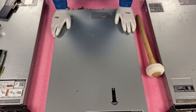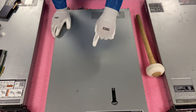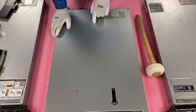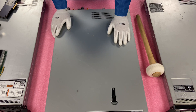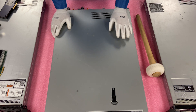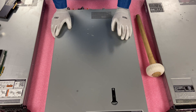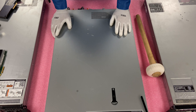Now we're going to show you how to do step-by-step instructions for slot bifurcation, which you will need for the M.2s. One thing to note on the PCIe version — you might run into a situation where your slot is actually disabled, which sounds crazy, but that's actually a setting. So you might need to enable it by going into the BIOS under slot disablement to be able to see it.